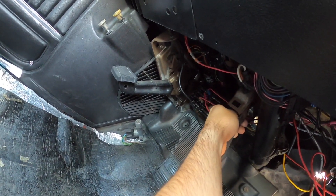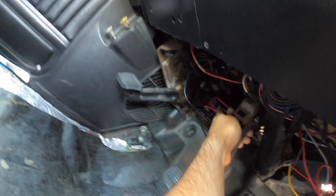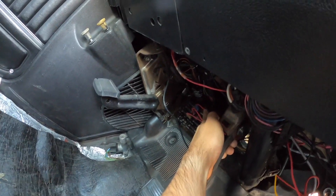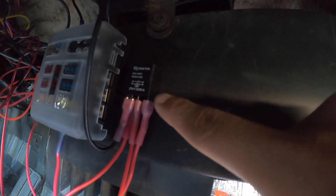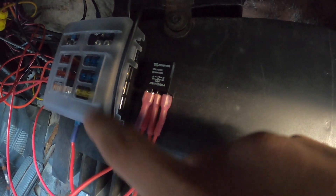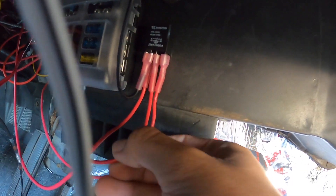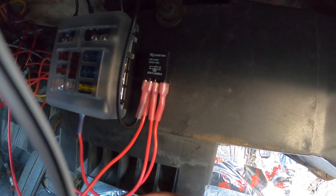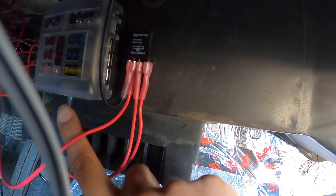This accessory wire acts like a switch. Whenever the car is in accessory mode or running, it turns on — keep in mind accessory always shuts off when you're cranking the car. So if you have a gauge light connected to that, once you put it in accessory mode it turns on. Since we have it hooked up to this relay, it acts as a switch: once that turns on, it opens up power to this fuse box.